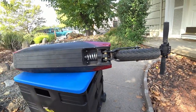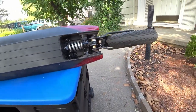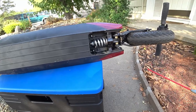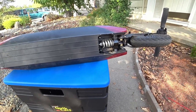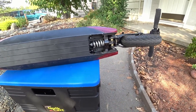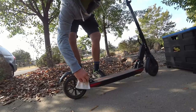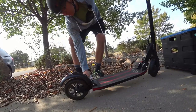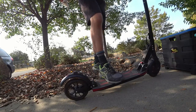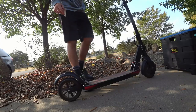I'm going to hit all these little spots with some WD-40, basically hitting all those pivot points. A lot of times WD-40 is not really the best choice for things like chains because it tends to attract dust, but for a spring like this I feel like it's an acceptable use and it's easier to get in here than bearing grease. I wiped off a little bit of excess WD-40. One of the other nice things about WD-40 is it works really well for cleaning off grime. That little bit of noise is now gone — let's do a quick ride.